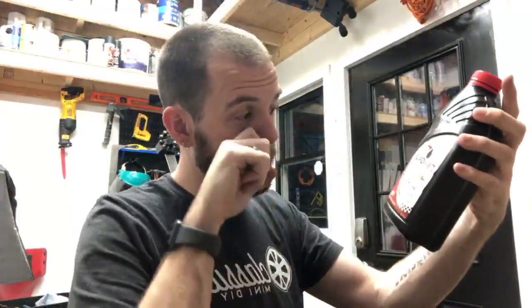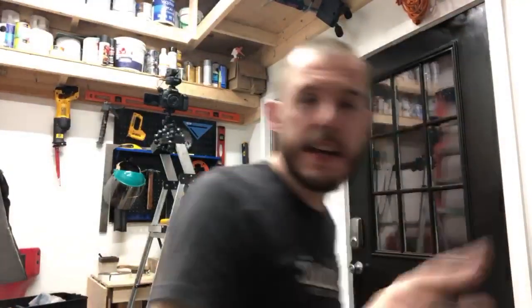Mark says, thanks for the info, Cole. You're very welcome. Junkroom says, what kind of oil do you prefer? There is no real opinion here in the German community. There's two brands. I said this a little earlier. I've got one sitting down here. I've been using Brad Penn, and it's called Penn Grade now. It's 20W50. This oil is great, partially synthetic, and that's good. And then I also use Valvoline VR1. The key, no matter which oil you use, is to have high zinc content. That's what your motor needs. No matter which oil you grab, just make sure it has high zinc levels in it.